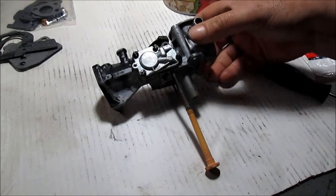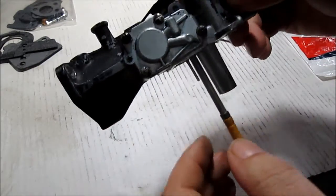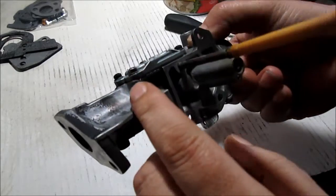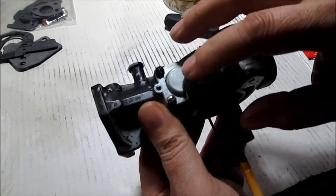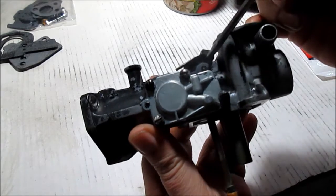Okay, hopefully if my video editing turns out alright, you'll see photos and then you'll be back to hear me showing you. Make sure your gasket's not bunched up. Go around, look at the edges, make sure it's flat. I put the spring in with the cup on top first. I laid the gasket on, put the lid on, and you'll notice there's an extra hole.